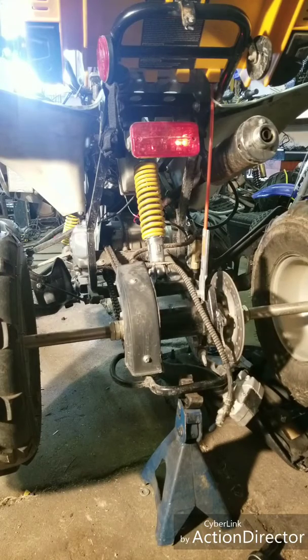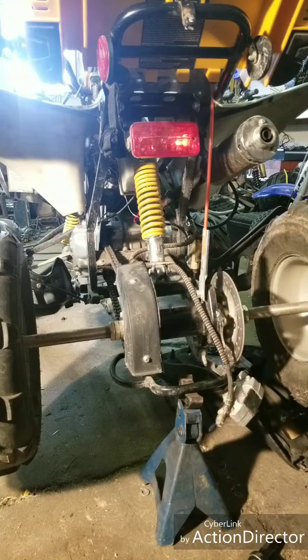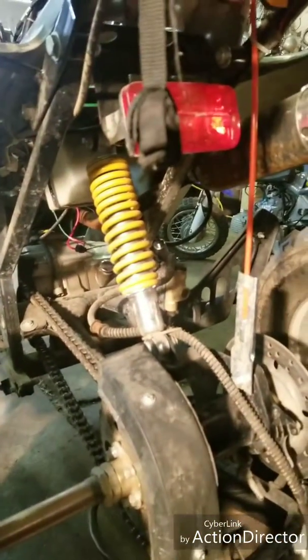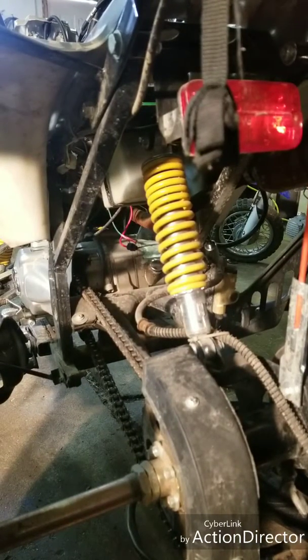The other way will make everything loose. We want to make it tighter. We've already got them all loosened up, so now we're going to be adjusting the chain and pulling it back. We'll try to bring the camera a bit closer so you can see the chain movement as I make my adjustments. We'll aim for about a half inch.